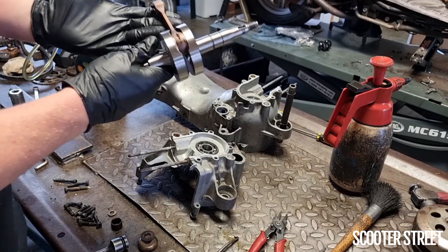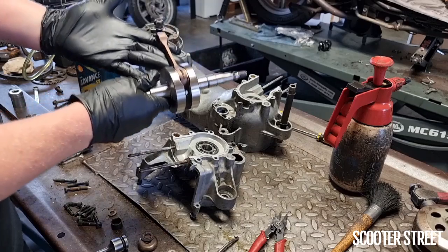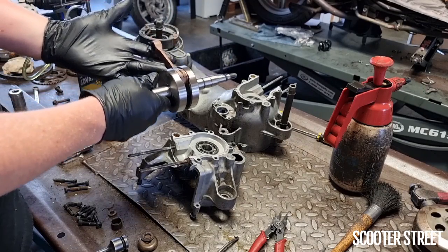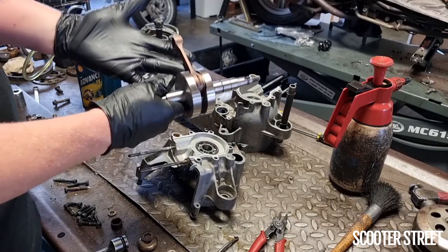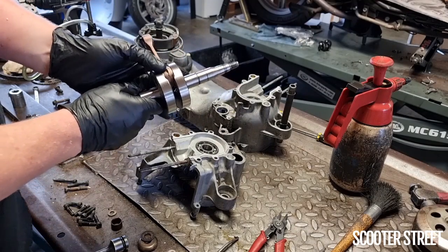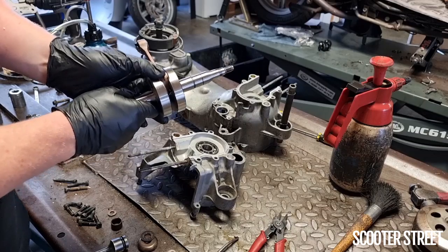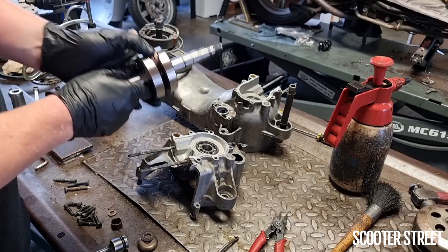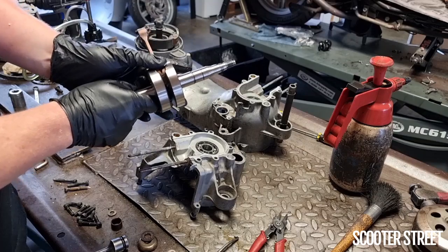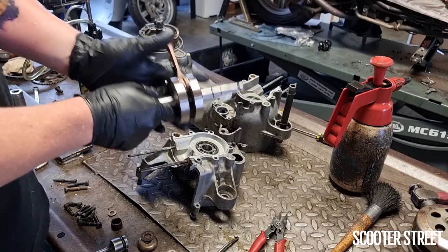It's a dry bearing. There's a reason that you have two-stroke oil in your two-stroke. There's a reason that in four-stroke scooters the bottom of the engine sits in a bath of oil, because mechanical moving parts, in particular bearings, in fact most imperatively bearings, must be lubricated. They cannot be dry. They have excessive movement when they're dry, and they can burn out and damage the engine.